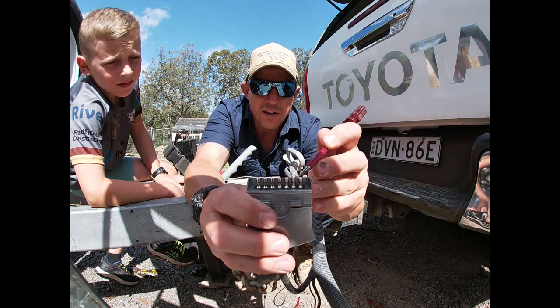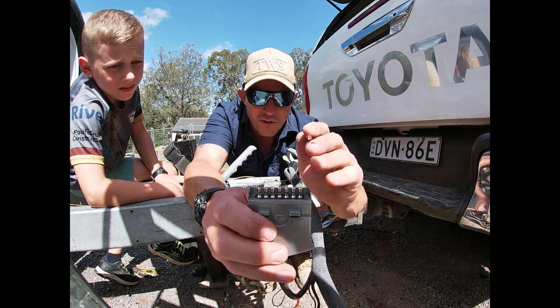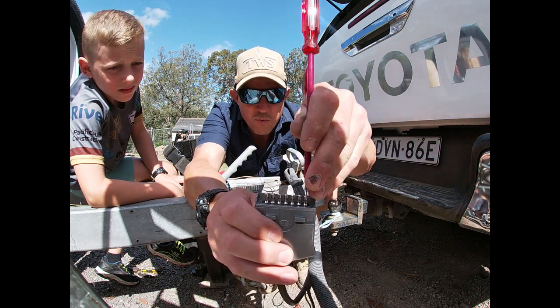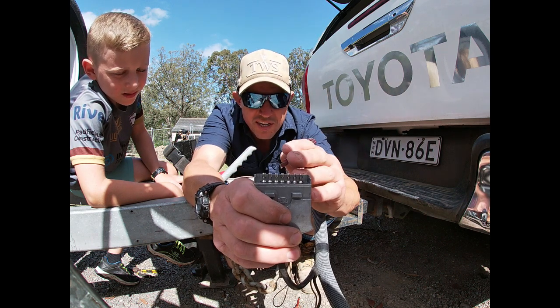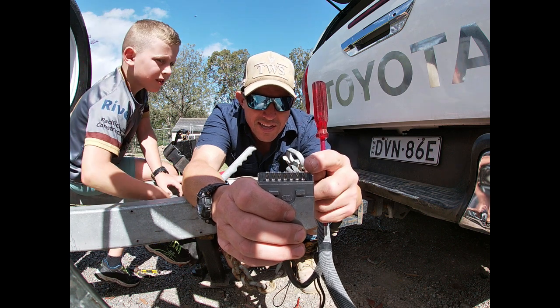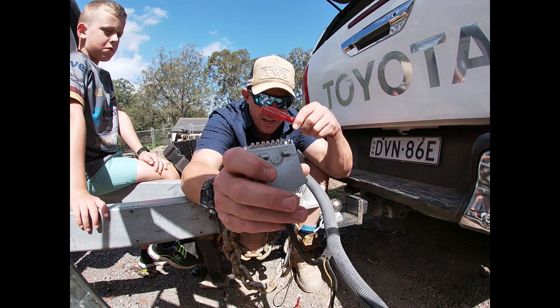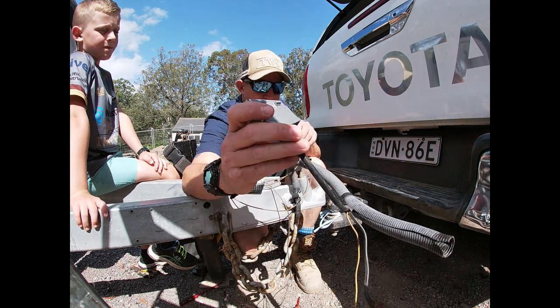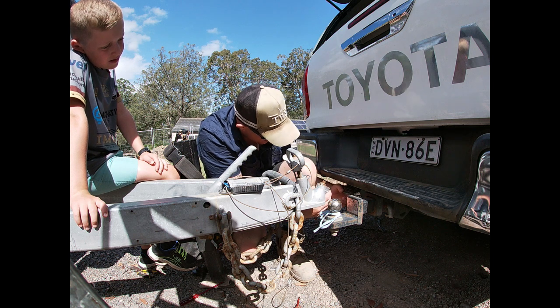If that happens, you need a small screwdriver like a jeweler's screwdriver or a sharp knife, and just wedge it in there and spread those pins apart again — not too far because you'll snap one off, but just enough so it's slightly bigger than the hole. That puts pressure on it, stops it falling out, and you get really good traction.